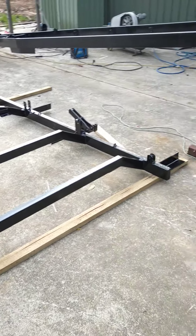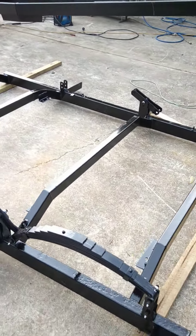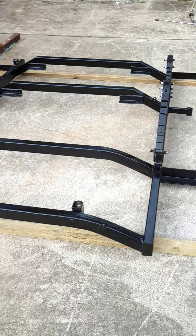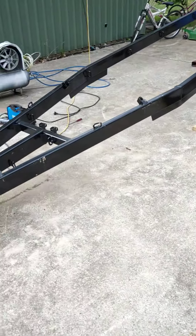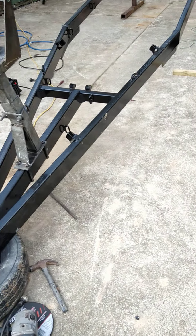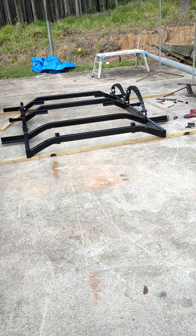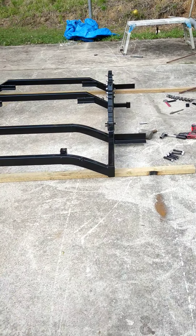I'm looking at another solution — whether I can put a hardener in it. Once it's all together I'm going to go over the whole trailer again with a few coats of paint because the penetrol works amazing but it's still been a little soft and hasn't gone fully hard. So if you're looking at using penetrol, your paint's not going to set properly — first time using it, live and learn.